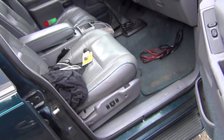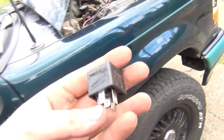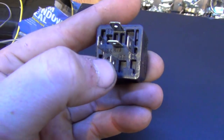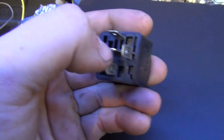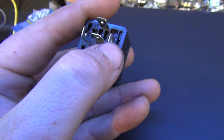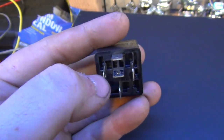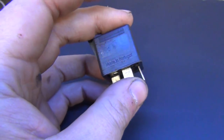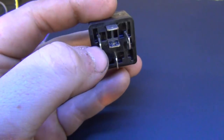Now as for wiring these — these ones have two outputs on them, they're more for like turn signals. So I'll show you how this works, it's pretty easy. This right here is going to be your power in from the battery, and then these two are your source. This is ground, so you'll run this to the body or the battery, which would be a little bit better. And this here is just your 12-volt, or even a 6-volt trigger source. I think these will run down to 6 volts if you really had to, but 12 volts is normally what you'd run them at.